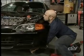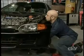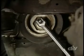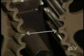Before you remove the timing belt, you'll have to rotate your engine to top dead center. On the Civic, you'll have to jack the car up and reach in through the driver's wheel well to turn the crankshaft. Since this is a running engine, we can check the marks on the camshafts to verify top dead center.